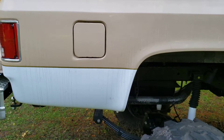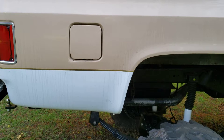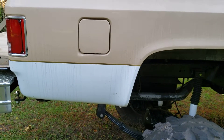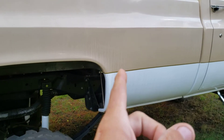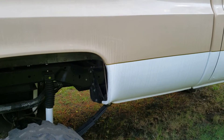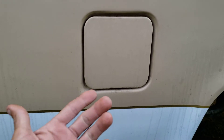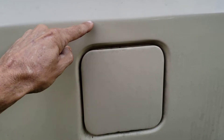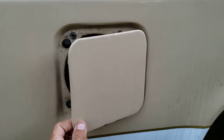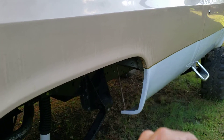Here's another part for the suburban fuel tank — I guess I missed this part on the revised video. For the opening, whether you decide to have it on the driver's side or the passenger's side, either way you're cutting out the section from there and then transferring it back. That's going to be the easiest way to do it. I cut mine out probably a couple inches out from the edge, so this whole piece is all from up there, and then I just use sheet metal to fill in the hole that I cut out.